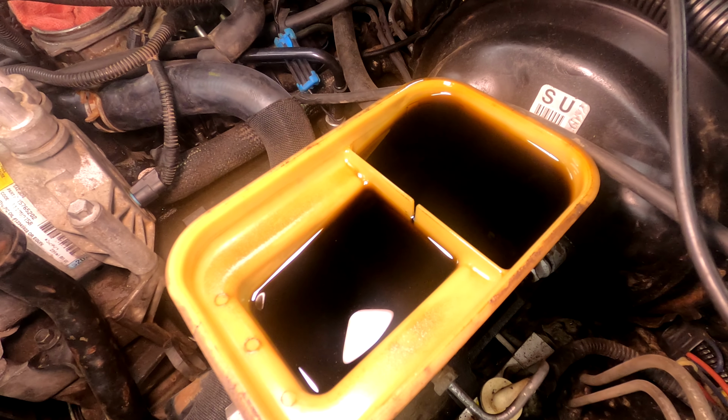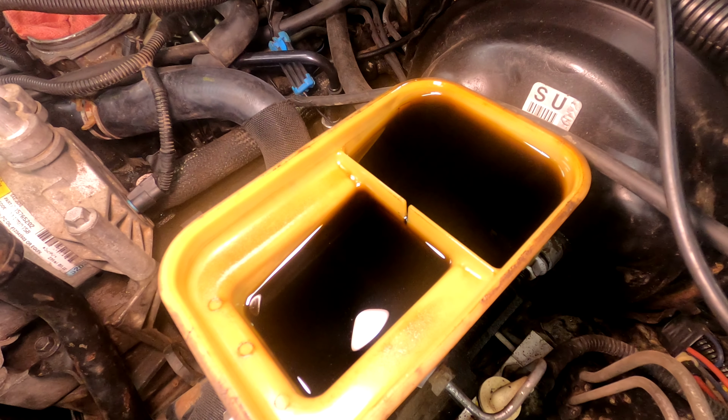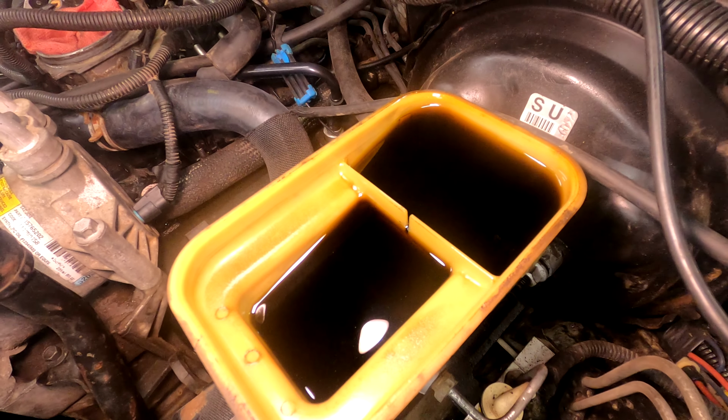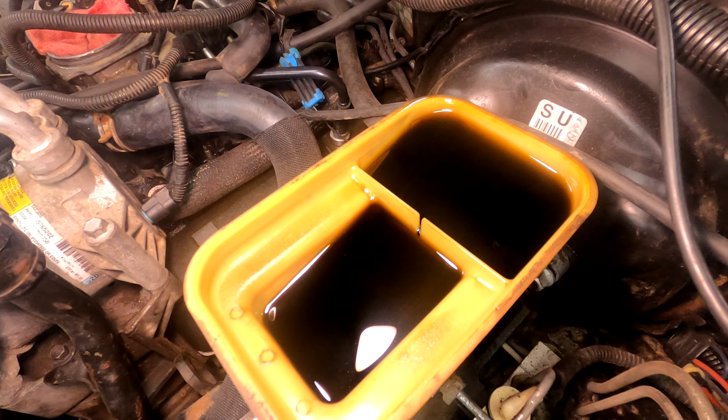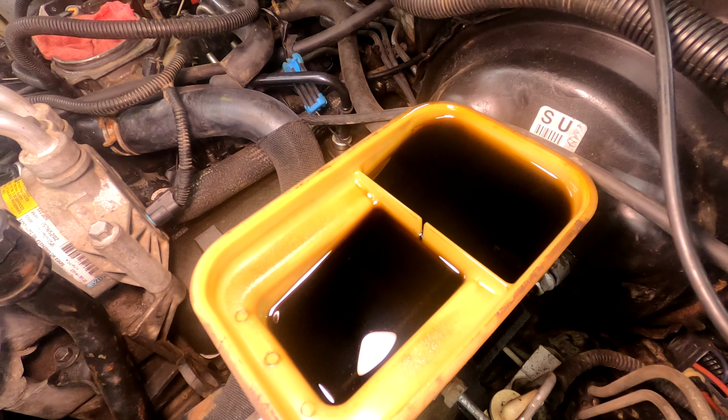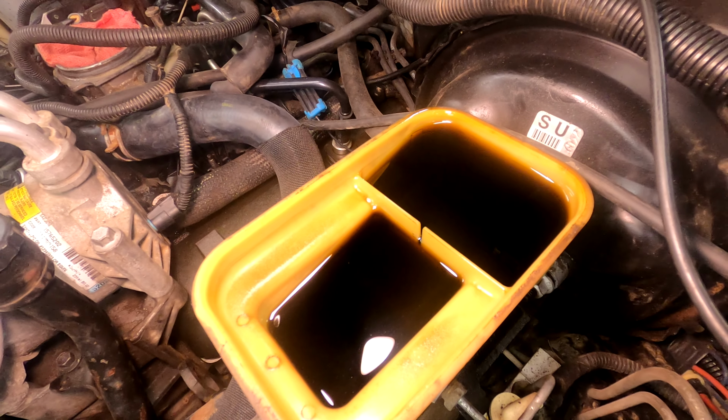Welcome back. It's another day working on the S10. You get the brakes bled, fuel filter changed, maybe refill the rear differential, exchange the fluids there, and we're going to get after it. So we're going to do a full fluid exchange. I'm going to use the vacuum bleeder, and we'll get this all chocolate syrup sucked out of here and nice, clean, fresh fluid in it.